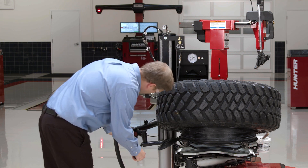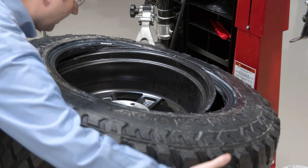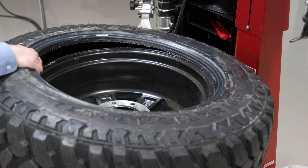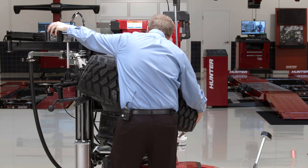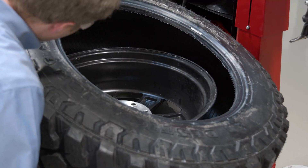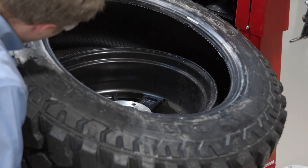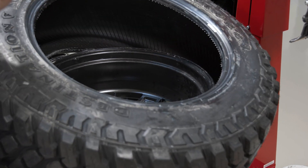And again, lock it in place. Just sort of keep the opposite end of the tire in the drop center as you're coming up with that disc, until you see that disc kind of come up and over and start to crown. There's obviously a very, very large tire here — and big wheel.